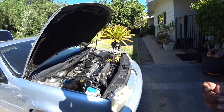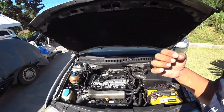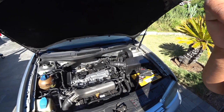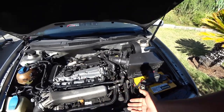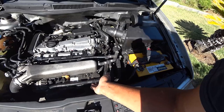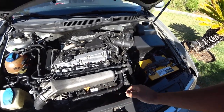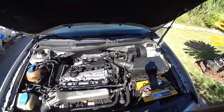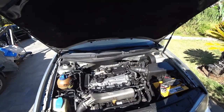The next step is turning on the car. Now with the car on, what you want to listen for is a hiss — like a 'ssss.' That noise means there's a vacuum leak somewhere. With the car cold or kind of warm, put your hand down here and wiggle the lines around — don't push hard on them, just wiggle them. The reason is that sometimes you'll crack open the vacuum leak and then you'll know if you have one there or not. If you don't hear any weird hiss noises, you're good.